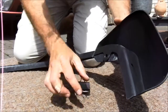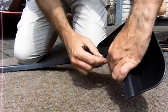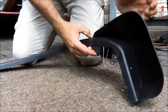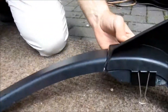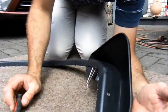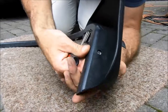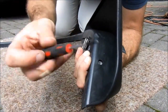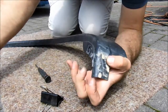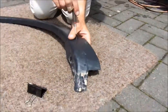So what we need to do now is take a bulldog clip and put that so the two parts are exactly where they would be on the car, with this piece being held on by the existing fitting on the car. It doesn't matter if it moves a little bit because the hole you're going to drill is plenty big enough. Just note that the gap along the top here isn't quite flush — it sits about a millimetre below, so that's absolutely normal and that's where it should be. What you then do — and you can make this easier by putting some masking tape underneath and marking it with a pen — is you just hold it tight, take a sharp pointy screwdriver or a gimlet, put it in the middle of the hole marked. Do the same on the other end, and what you're left with is a couple of guide holes.